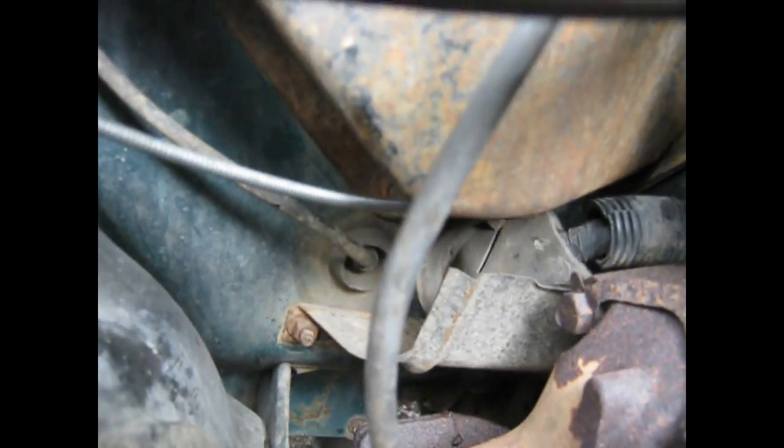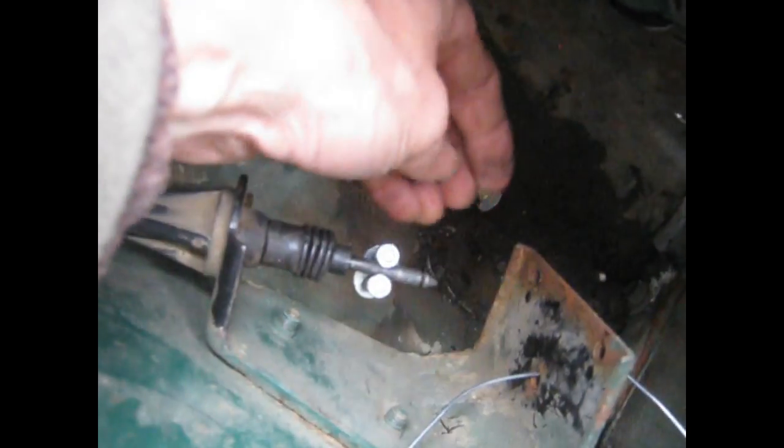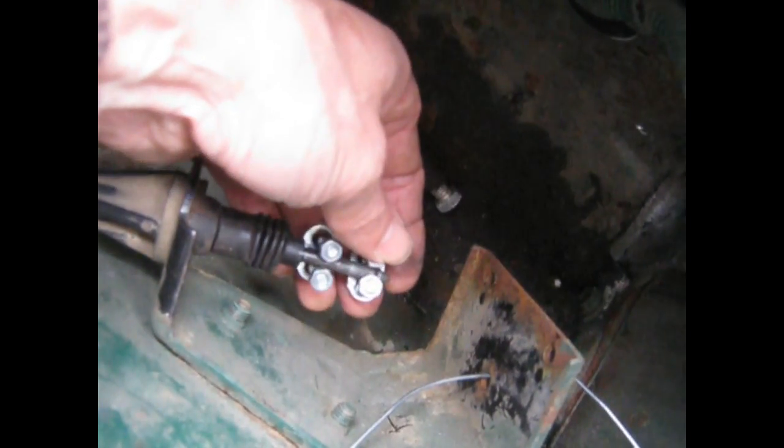And let's start back here. There's where this shiny cable is coming out of a seal under there, underneath your heater fan. And I've wrapped it through the body, through the fender, and it comes out here. And it's a nice lazy loop. It's going to get hooked up onto the front differential cable. So when the cable is pulled out and locked, and this wire here, it will be set with a couple of clamps. And these clamps have a nice little tooth flange that will fit into this little notch that the original lock washer to the vacuum actuator went. So I'll take a look in a bit.